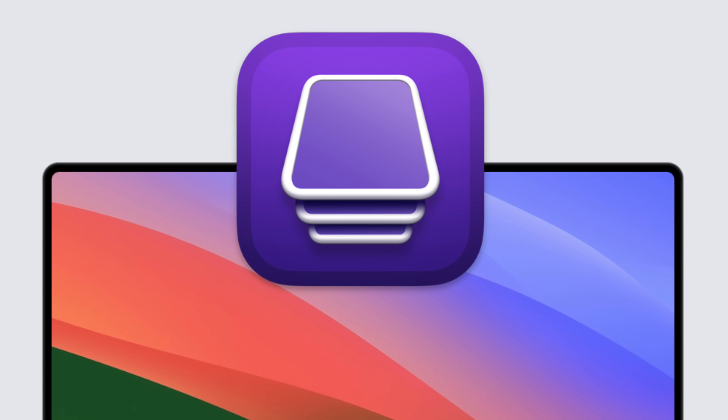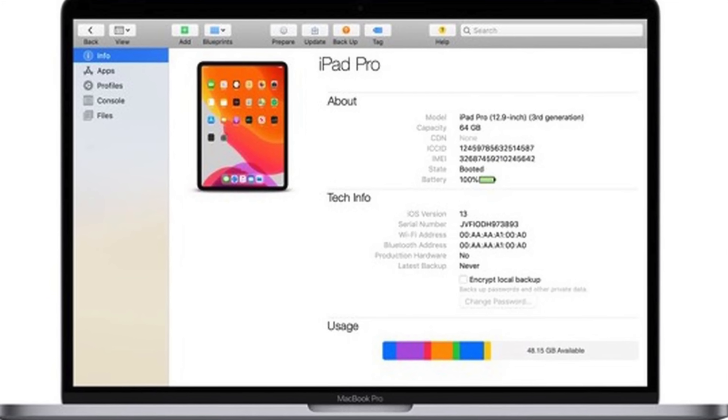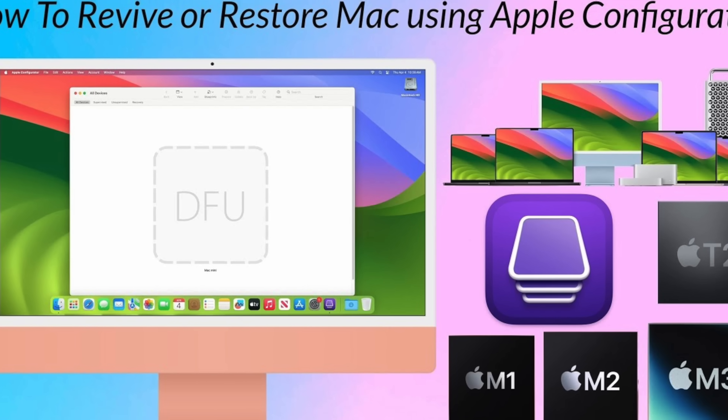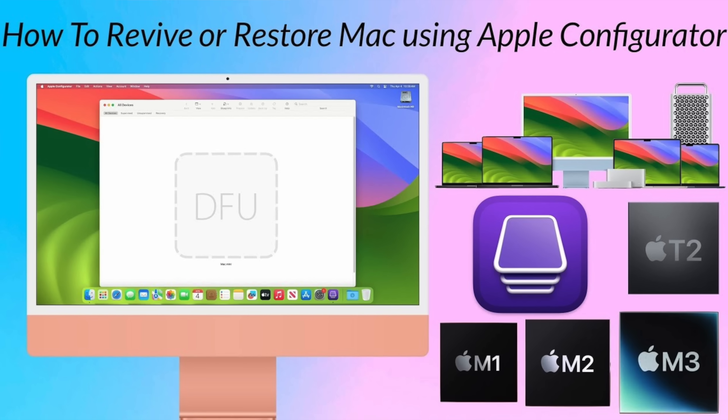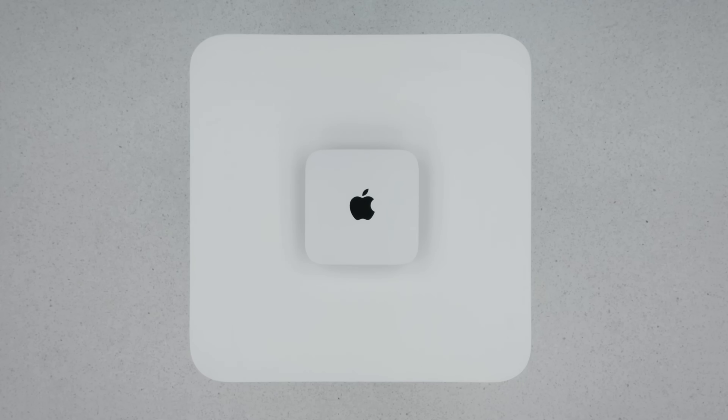The point is, having a module means that at some point in the future it is possible that Apple will allow users to plug their computers into Configurator and flash new storage onto their computers if they're willing to open the computers up. I'm not holding my breath on that yet, but Configurator is quite a powerful tool — for instance if you corrupt the firmware on your Mac Mini, which is something I've done, or if you want to mass deploy things. With the old Intel Mac Pros with the T2 chip, you could upgrade the storage and then flash those things to the actual Mac. We've seen the Configurator tool used to actually tie memory to a secure chip — that being the T2 chip — for new SSDs. So it's not out of the realm of possibility. For me personally, all this really does is make the decision to buy an M4 Mac Mini that little bit easier because it comes with 16 gigabytes of RAM at the base, and it has a modular SSD so that if I do decide to upgrade, I might be able to do that.